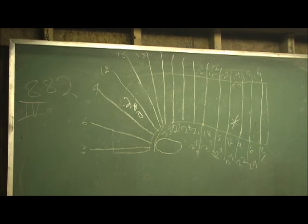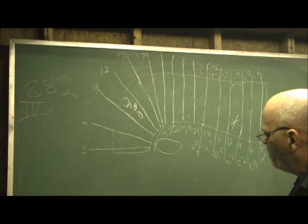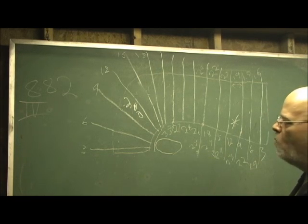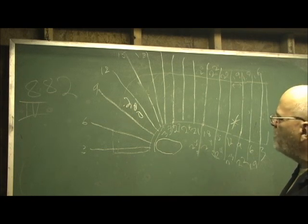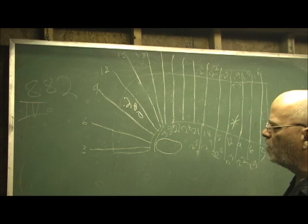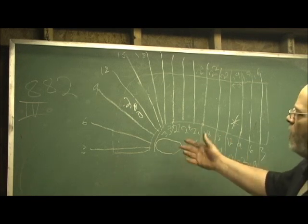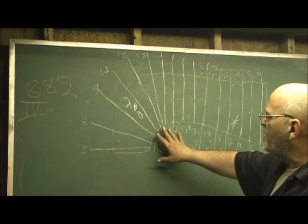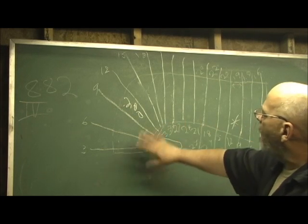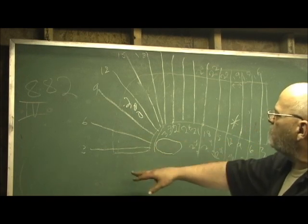This is an area you chop a considerable amount and do a lot of work to — this roll of radius right here, enlarging it for the bigger valve. I call it tiger striping the port. I'll have this whole thing sonic mapped out. On a head like this, I'm doing stage four, and I know what they are — I've done so many of them — but this ain't maximum effort by no means, and that ain't what she wanted. You go getting them too big with too much cubic inch and you run into problems. Then there's the money issue. Having that sonic thickness map plotted out, you've got to do it 16 times — eight intake and eight exhaust.